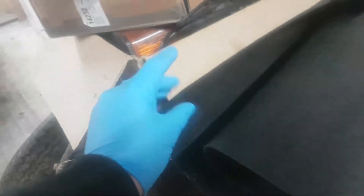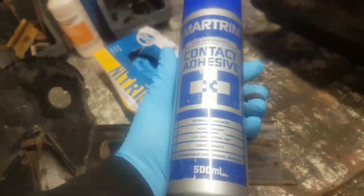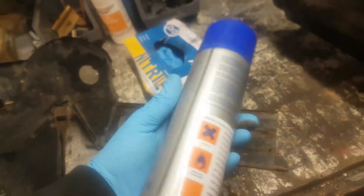First and foremost, I think I can see where the water leak has been. It wasn't actually the matrix — it was the bottom pipe on the heater. It looks like it's been squirting water into the matrix; you can see the pattern of rusty water going in. What I drained out of the radiator was all full of rusty water too. Now I've got some foam — really quite dense foam that doesn't soak up water — and some rather marvellous mild trim contact adhesive. This stuff deals quite well with working in hot situations; I've used it in the past for gluing headlining fabric to an existing board. I'm going to need to cut each one of these foams to go onto these areas.